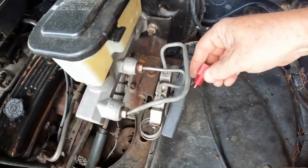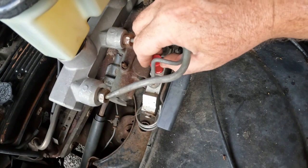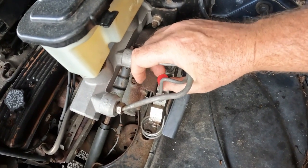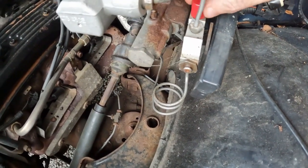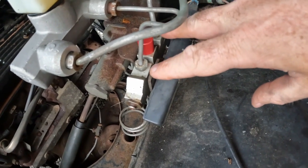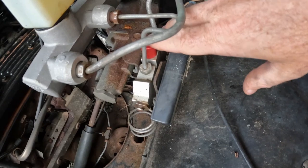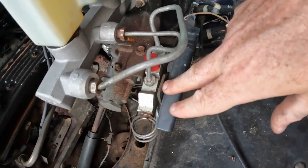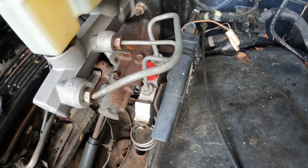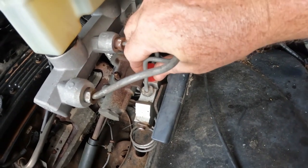I can't see down in there to see where the spool is. I'll try to thread this in and see if it makes any difference. I'm looking at the pin out here on the end to see if it moves any. It's bottomed out — there's just a spool in there. Whenever one line breaks, it shifts and favors one side; if the other line breaks, it shifts back and favors that one. But when you try to bleed it, if you haven't got this lock in there, whenever you try to break the bleeder screw it might shift and block off the one you're trying to bleed. So this centering pin holds it in place.